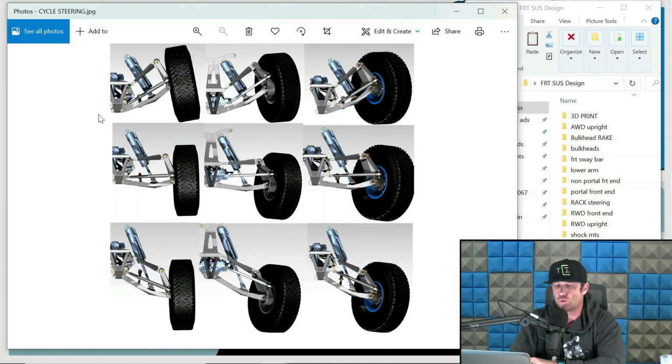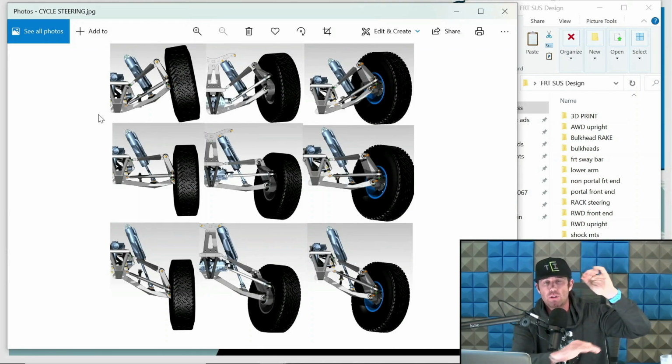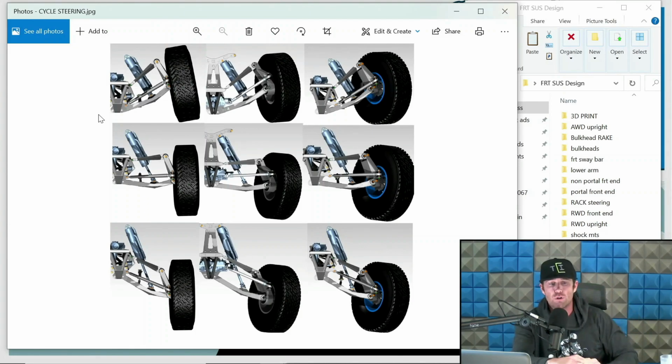droop. I like to use the term droop in relationship to the limit straps set up on the extension side of travel. Where if you have the truck in your shop and it's just static and you let it hang on the limit straps, that's the start of your droop travel. The end of your droop travel will be at strap stretch under load. When you're out racing and you're coming through stuff at speed, the straps will stretch more than you see in the shop. So that chunk of travel is what I'm referring to for droop travel.